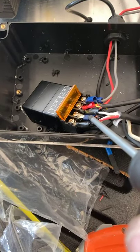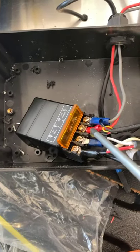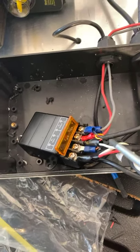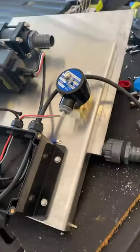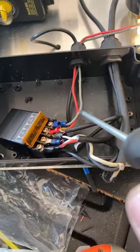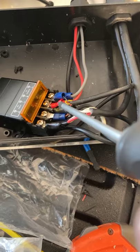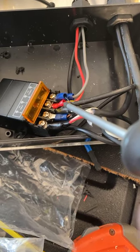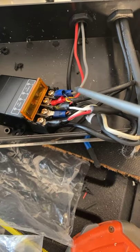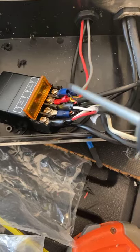Your negative wire goes there. On these 12-volts you have a white wire — it goes to the third screw from your left. Remember, start from your left. Now on this one I've got a strobe light and a 12-volt solenoid. Your 12-volt solenoid is going to come with a red wire and a gray wire. You're going to hook where your white wire goes, hook your solenoid there, and hook your strobe light onto that one. Your second solenoid wire goes there, and your second strobe light goes to the far right also.